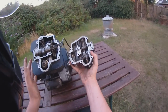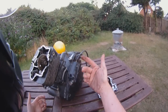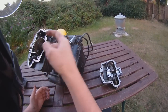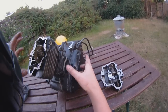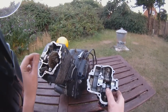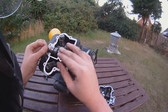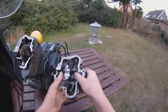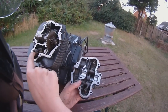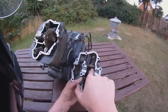And you've got the valves. So what happens is, because there's sort of two sides to an engine — we'll start with the piston going up and down, which is done by fuel and air mix. Now running off the piston crank is the cam chain at the bottom end of it. So this runs to the top, and by these turning at the same time, they can time when the valves are pressed to release the fuel and air mix and to let the exhaust out. As the cam chain goes around, it turns the cam. So as the cam's turning, you've got a lump then a lump — that corresponds to these, which are the rocker arms. These get pushed up and down by the cams, and by being pushed down it makes the valve push down, which releases either the fuel in or allows the exhaust to come out. That's then returned by the spring of the valve.